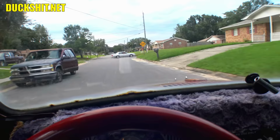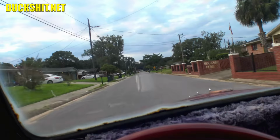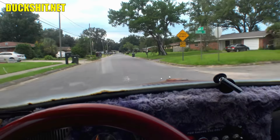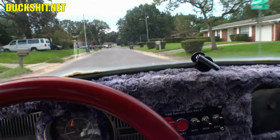It does run just a stock carburetor, but it has that typical 009 hesitation. And that's typical of a centrifugal-only advanced distributor. It needs a vacuum advanced distributor on it. All Volkswagen cars do. Only industrial engines are supposed to have a 009, and I don't care what anybody says, 009 runs like crap.